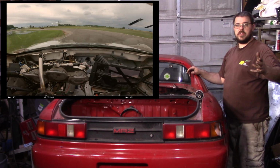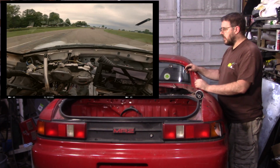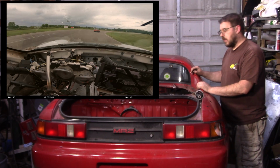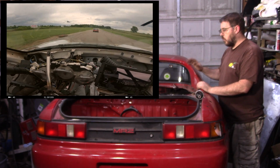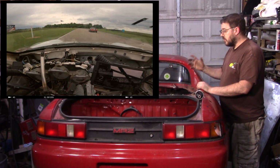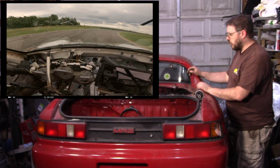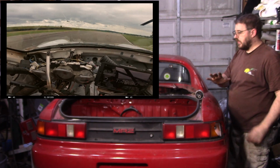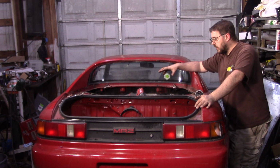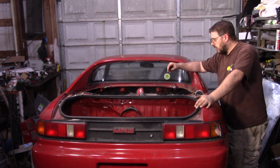Remember, I raced it. Now, here you can see some footage where I raced it. No issues. The ECU had to take a couple degrees of timing out here and there. I definitely would have had more power on alcohol, but it ran perfectly fine all weekend. So that is an option. And those pistons are just $60 a piece, $65 a piece, maybe, straight from Toyota. So hopefully that won't be needed. It definitely won't be needed to get good numbers out of it. It just might be needed to achieve that 250 target that I'm talking about.